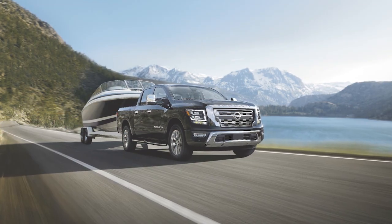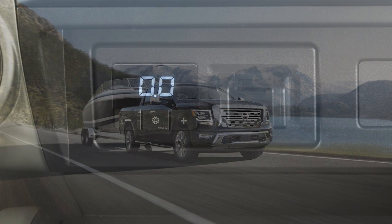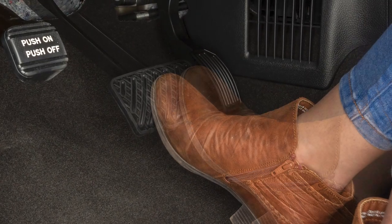The TBCU has two operating modes: automatic mode and manual mode. The automatic mode is the normal operation of the TBCU depending on the gain and boost settings adjusted by the driver. This mode is activated when the brake pedal is pressed.